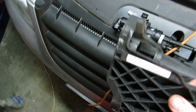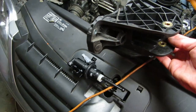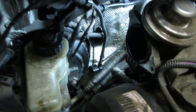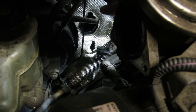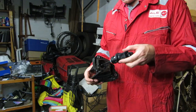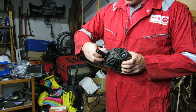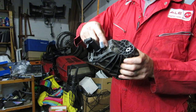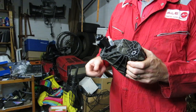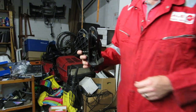That will twist-lock in there and that end will stick through. We will reinstall the clutch pedal and then install this whole clutch pedal assembly from the inside, and then connect everything back up. It will come through right there — we'll connect the feed pipe, the electrical plug, and the actual hydraulic line. This is actually a really simple installation. The master cylinder only slides in here, it has a rubber seal, so it will slide in until it's in place. You then rotate it clockwise until this little hook clips into place and then it's ready to get installed. This little tab we will leave on so that no dust or dirt can get in there.